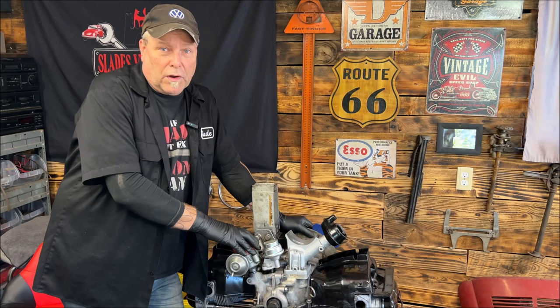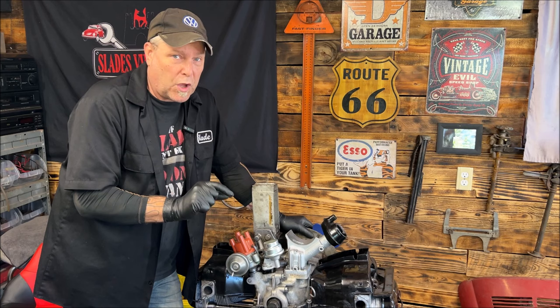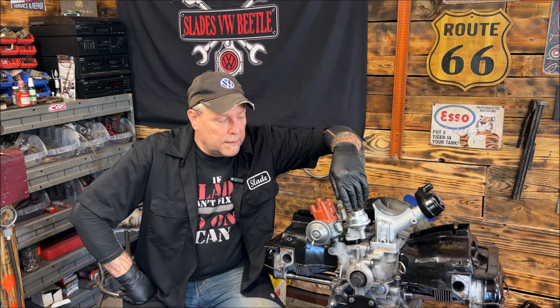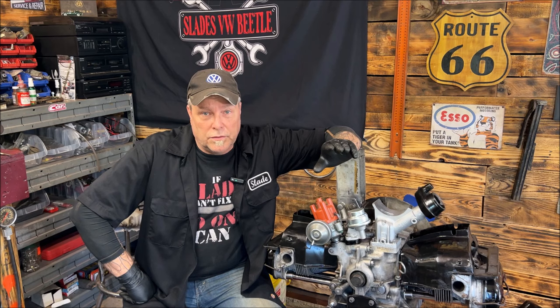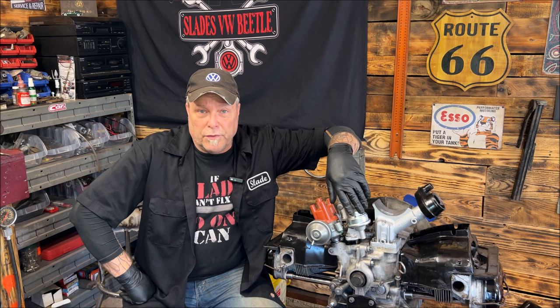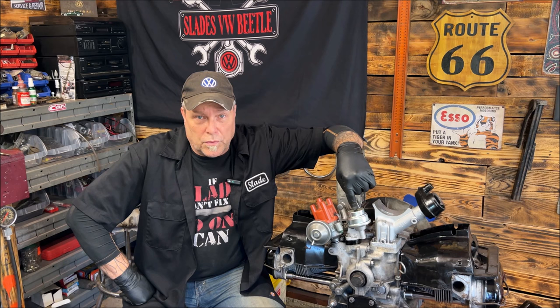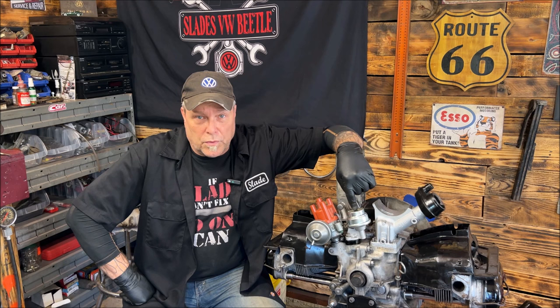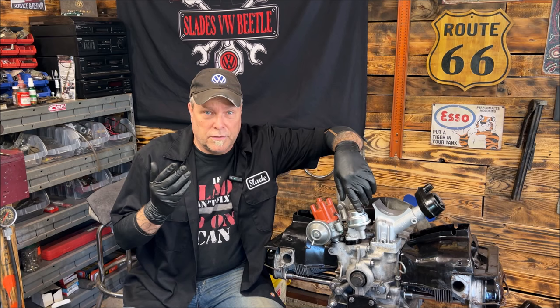That's odd — I've always been able to use my small socket to get in there but it's not allowing me. It might just be something different designed on a newer fuel pump. So on fuel pressure: the factory manual calls for about 2.8 psi at approximately 3,400 rpm. These new fuel pumps pump more pressure than usual for the most part — they have a harder diaphragm which is not as flexible, so it ends up causing more pressure — which gives you too much fuel pump pressure.